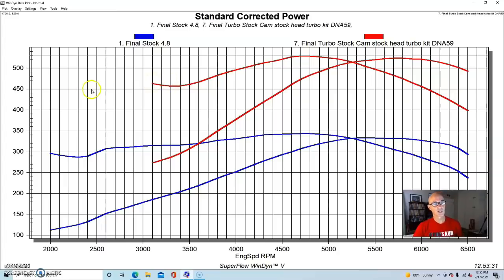And if you had boost there, if you size the turbo correctly, and I don't know that I would recommend the GT45 for this application, maybe something a little smaller, but if you wanted low speed torque at 2,000 or 2,500 RPM, the other thing to remember is if you're running this with a stock converter and all of a sudden you're adding 150 more foot-pounds of torque, basically adding 50% torque down at 2,000 RPM or so, you're going to raise the stall speed of the stock converter, because the stock converter isn't an absolute number. It's based on the power output or the torque output. And if you increase the torque output dramatically, you're going to increase the stall speed as well. So all of that's going to work out fairly well.